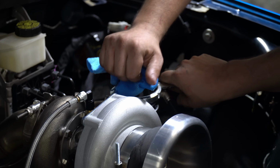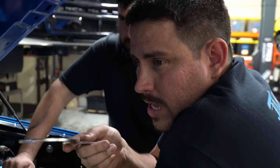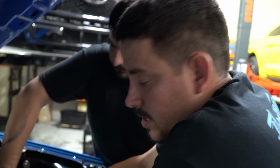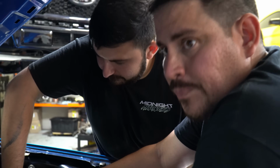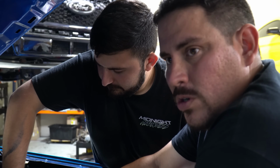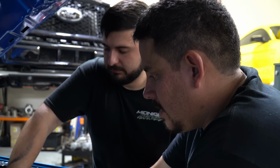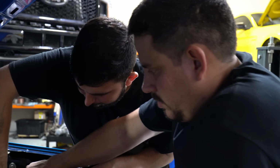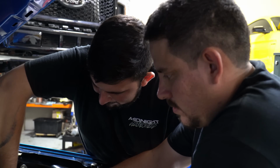These turbos have been on 12 pounds. 11.7 on the last one, 12.2 on that one. Same springs as the 62-62s, but the 62-62s made a little more. They made what, 20 more horsepower? Oh no, actually they made more. But these are journal bearings. So now we're going to go up to 15 pounds.